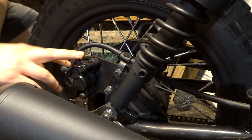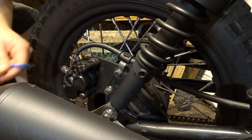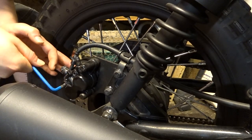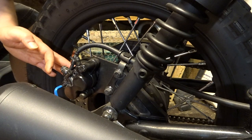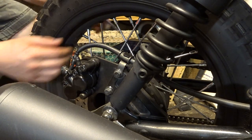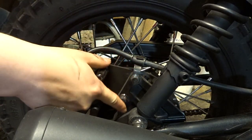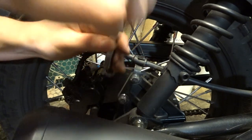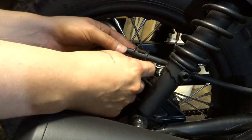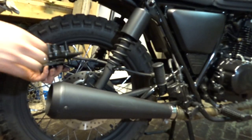To take off the brake caliper you'll need some good Allen keys. First, release these bolts — you don't need to take them out, just crack them loose, which will be much easier for the next step. Behind here where this pin is, remove it using the correct Allen key and loosen it up. Then remove these two bolts, take off the bracket, and the whole brake caliper system should slide off.